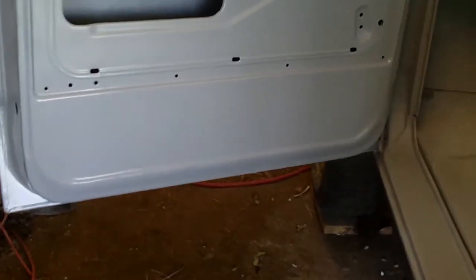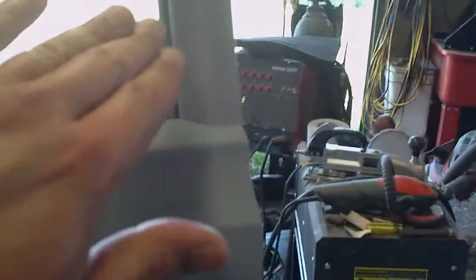So it's done. I finished the bodywork on the door and on the inside of the door. I hit it with three coats of epoxy just on the part that I was sanding. I straightened out one run that I had here on the outside and sanded that. I'm going to need to sand it right here with some 600 just to take a little bit of furriness off from where I had to sand another run off while it was still wet.